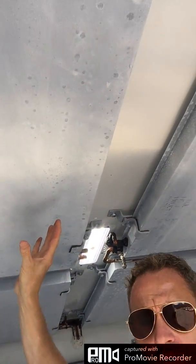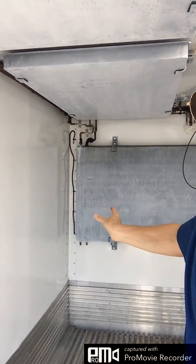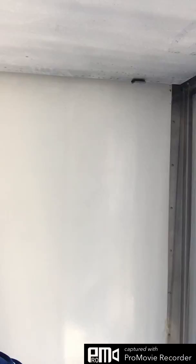One of the other things you see right away on the ceiling — I've got four cooling panels, and on the front wall I've got one. Again, for this application this is what was right. We wanted to do negative 20 degrees — he delivers frozen foods, this is what was right. These are the parts that get cold and keep the body cold. There's no thermostat control like a cold plate might typically have because it was engineered specifically for this product. This particular customer does second and third generation body swaps, so he wants to keep it going as long as he can.